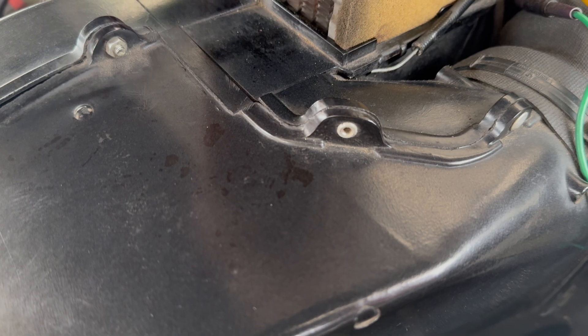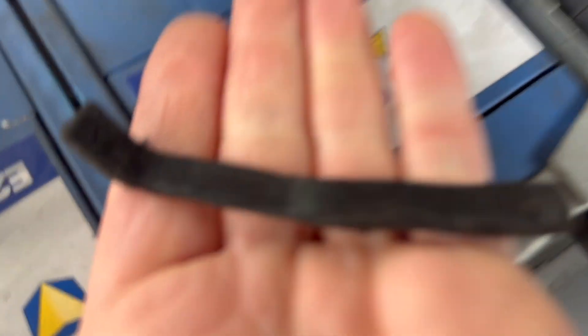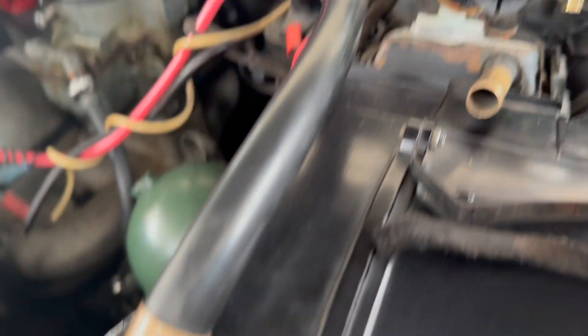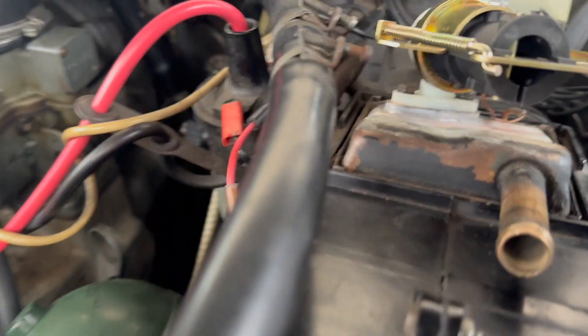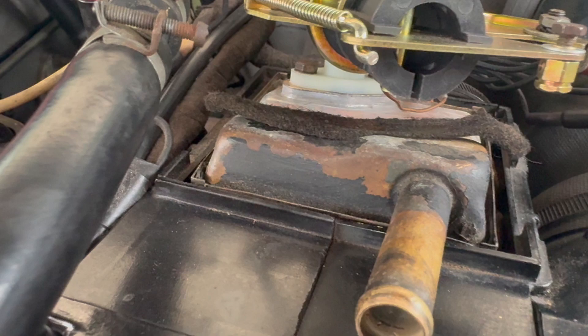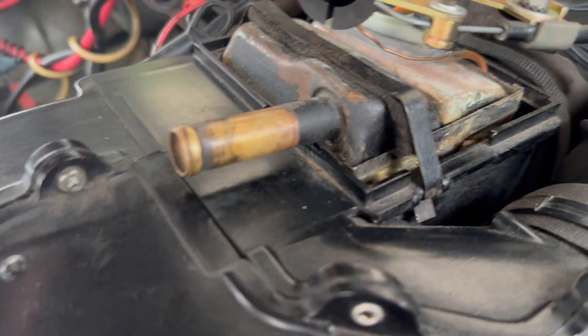I've put the valve back on. This foam around here is just to stop the hot air entering the cabin when you don't want it. That's gone in pretty well. Not only have I got the retaining strap, but I've also got a 52-year-old piece of felt that will go over there - yeah, that looks alright. Which is exceptionally good for my OCD. That's the matrix back in. Just got to split this pipe, put the inlet back on here and the outlet back on the valve end, and that should be that job done.